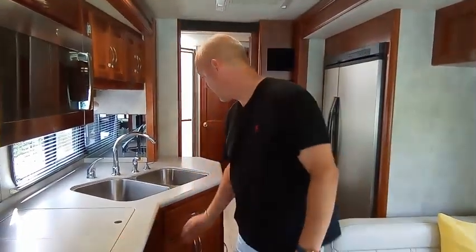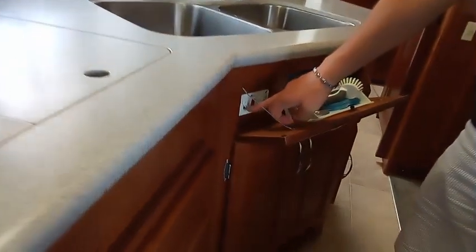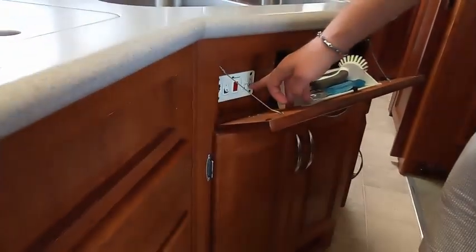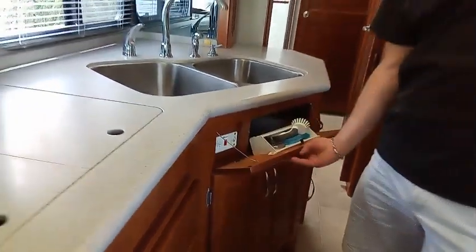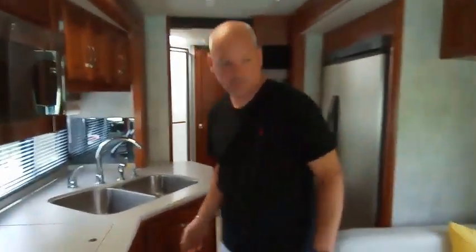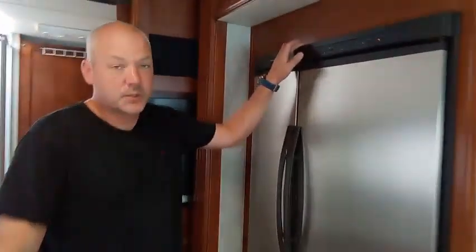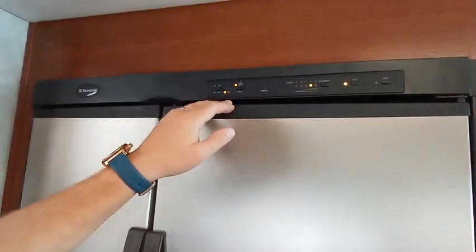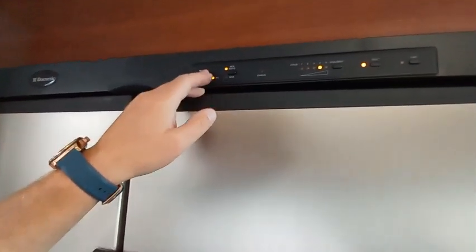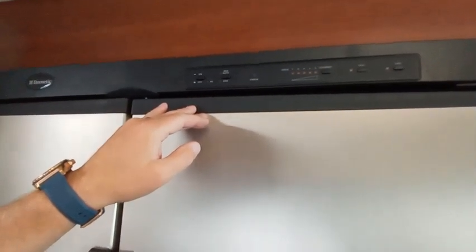While we're in the process of shutting down all the systems, you're going to want to shut off the water heater. It's turned on right now on electric — it can also run on propane. In our case we're running it on electric, so we're going to switch that to off. Both of those should be off, so now your water heater is off. You're also going to want to turn off your refrigerator. If you have a long ride you could have it run on gas, but after you're unplugged it's not going to run on AC anymore — that's the on/off button.